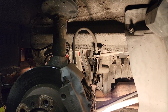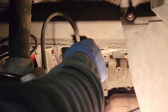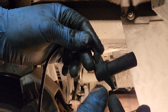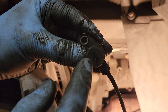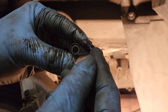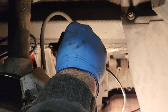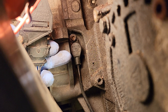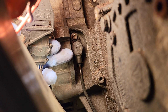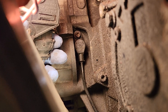Now I should be able to pull that sensor right out. I got it, and it's looking very crusty, so that's probably the reason it needs a new one. New one going in. The new sensor is in. I didn't go crazy torquing down that little bolt — I didn't want to strip it because it is very hard to get to. So I put it in snug, gave it an extra eighth, and then I'm going to go ahead and hook the wires back up to where they belong. We should be good to go.